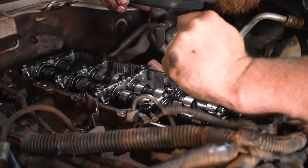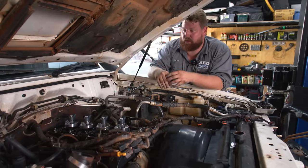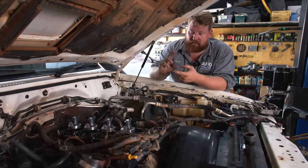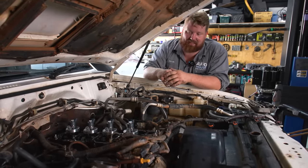We're just finishing up installing the injectors on the ZD. We're running with standard injectors — we haven't gone for bigger plus-30 injectors because we're not after big power, we're after pure reliability. With these injectors we should see a bit better fuel economy and a lot less smoke out the back than the old ones were producing, especially with 200,000 Ks on it. It's due for these.